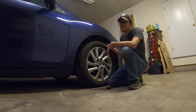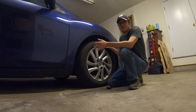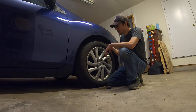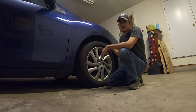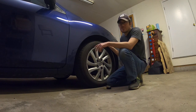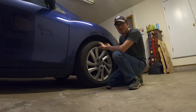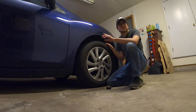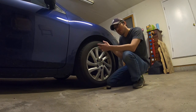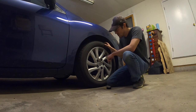Fixing leaks will help you in the long run and save on gas — good tire pressure helps your fuel efficiency a little bit. Another tip: once a year, pop open your trunk and check your donut spare. The donut has a different, much higher PSI rating than your regular tires, so be aware of that. Check it while doing your other tire checks, especially before traveling, because you don't want a flat donut when you need it.